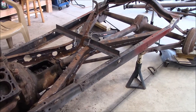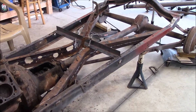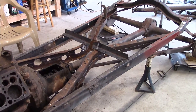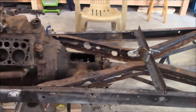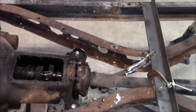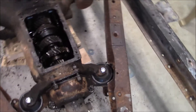A new day — I kind of gave up on putting that '39 X member crossmember in there and started working on putting an F1 crossmember in there, but it just kept bugging me that I wanted the '39. So after a couple of days of thinking about it, I went ahead and drilled out all the rivets out of the '39 X member, split it down the middle, removed what I needed to fit the front, and then tapered it in the back. I welded it all back together and took the transmission mount out of the '39 also, drilled that out and redid that a little bit.